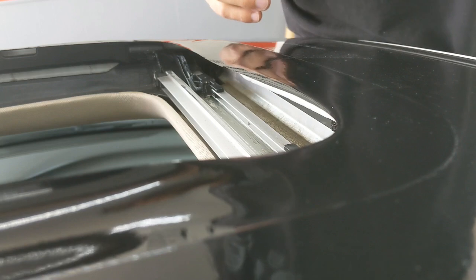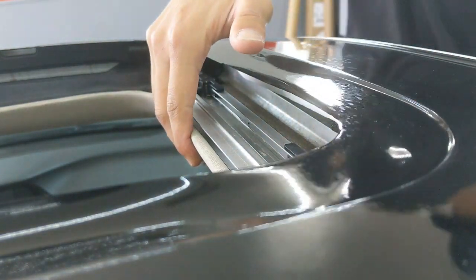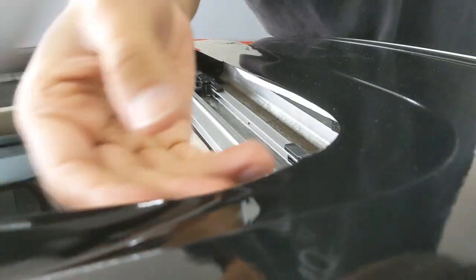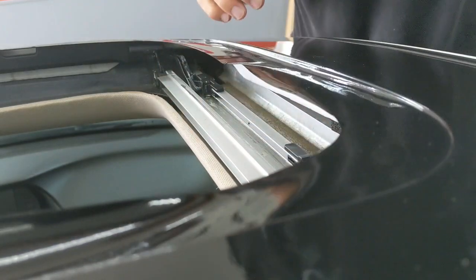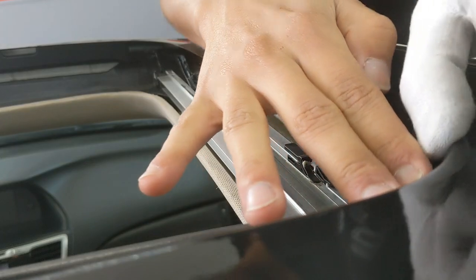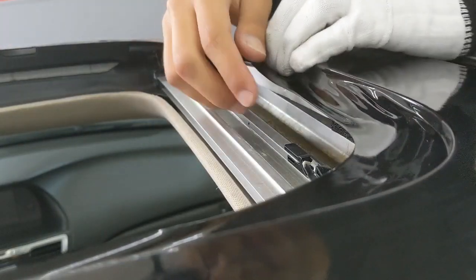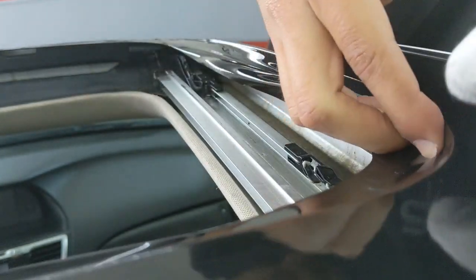Warm it up. And basically just work it in. Wrap glove. I don't know if you guys have worked with 3M 2080, but with the cap sheet, very grabby. Even with a wrap glove, especially like this ghost glove that's supposed to slide really nicely, it just does not want to slide over that cap sheet. So I've got it